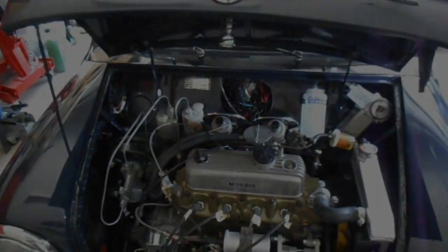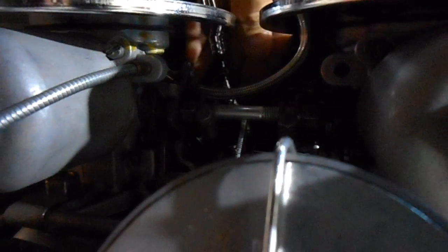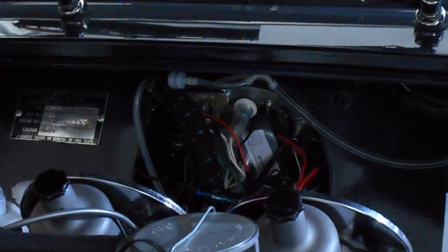All right, so let's start it up and then play with the idle adjustment. I'll just try and get you a bit closer so you can see what I'm actually doing here. I loosened this up and then adjusted the idle screw on this right hand side carburetor. Now what I need to do is just tighten up the nuts so they're both locked and move together. Right, so the linkage is tightened up again and they're moving together. I'll just start it up, see what the idle speed is, and then do some adjustments.